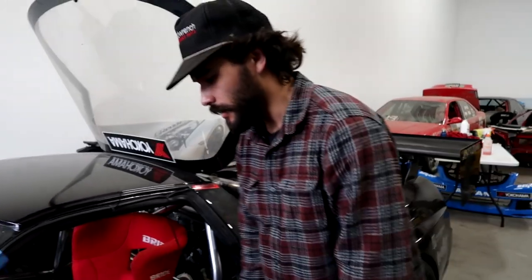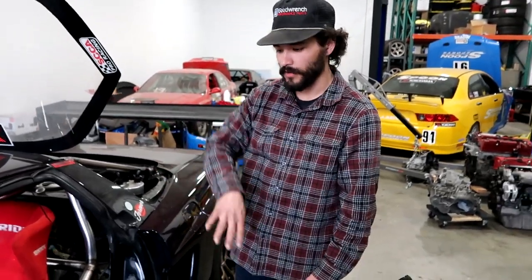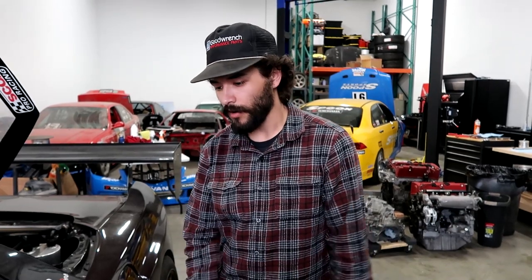They're bowed to give Amir as much space as possible with his windows and regulators. They're two continuous tubes — an inverted U and a U welded together in the center, then a taco gusset to really strengthen the whole thing. So ultimately you get pretty easy ingress and egress, and it's also very strong, very tight to the body and the car — probably the safest option as far as strength and rigidity. It's a style you'll see on an FIA GT3 car like the Porsche 911 GT3R or the Ferrari 488 GT3 — pretty much all of them run this style. It wasn't even in the SCCA rulebook, so we had to get clarification that we could do it.